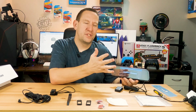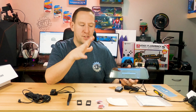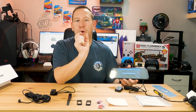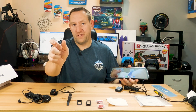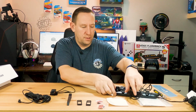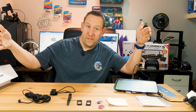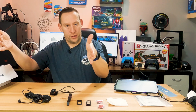Most file systems work with actual physical files. So when you set the loop record length, it'll record a 1 minute video, and then another 1 minute video, and then another, if you've set it to 1 minute. And after the memory card is full, it'll start recording a new 1 minute video over top of the very oldest 1 minute video, and then over the next oldest, and the next oldest.